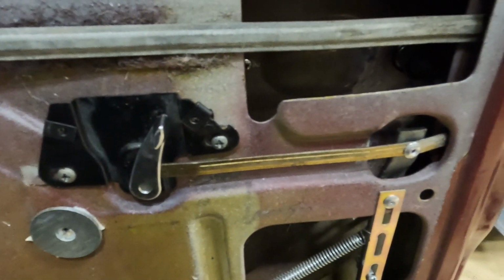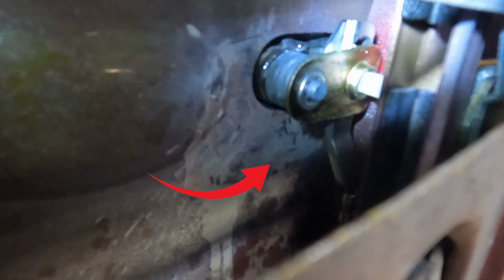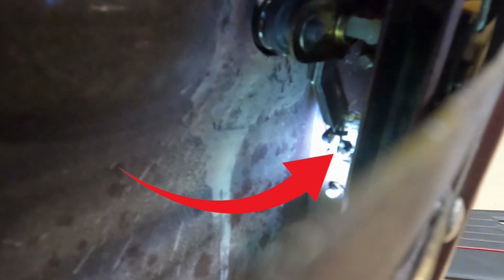There was a slight problem with that, and hopefully you can see that in there, but the lever there, the silver lever, that's the one that goes up and down, and basically it's just a slot in a piece of metal, and that little white plastic arm is when you press the button, that unlocks the lock for you. And what was happening was that sliding piece of silver metal wasn't going up and down properly. It wasn't even making it up and down, and the problem was that little lever just there, I'm hoping you can see all of this, that little lever down there wasn't going up and down enough, so I had to bend that very slightly to give it the extra few millimeters it needed to actually lock the door. So now it locks and unlocks exactly as it should do.